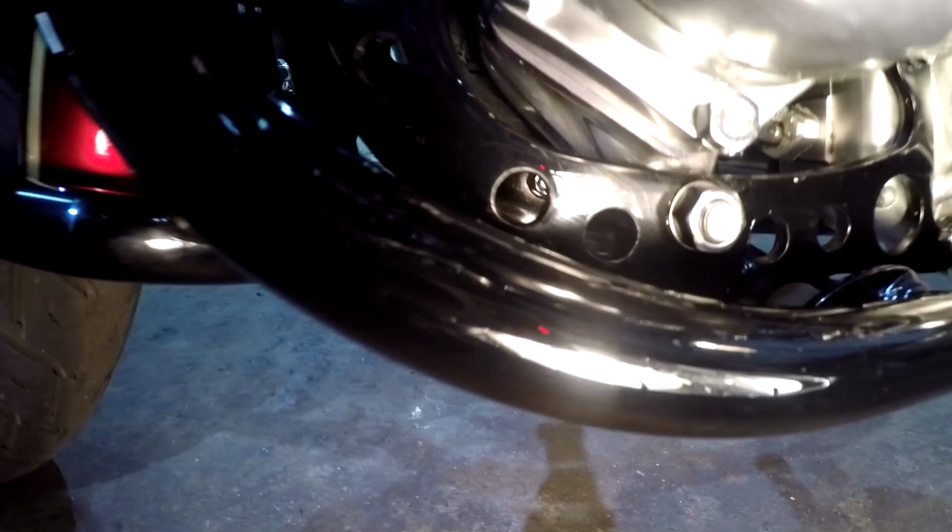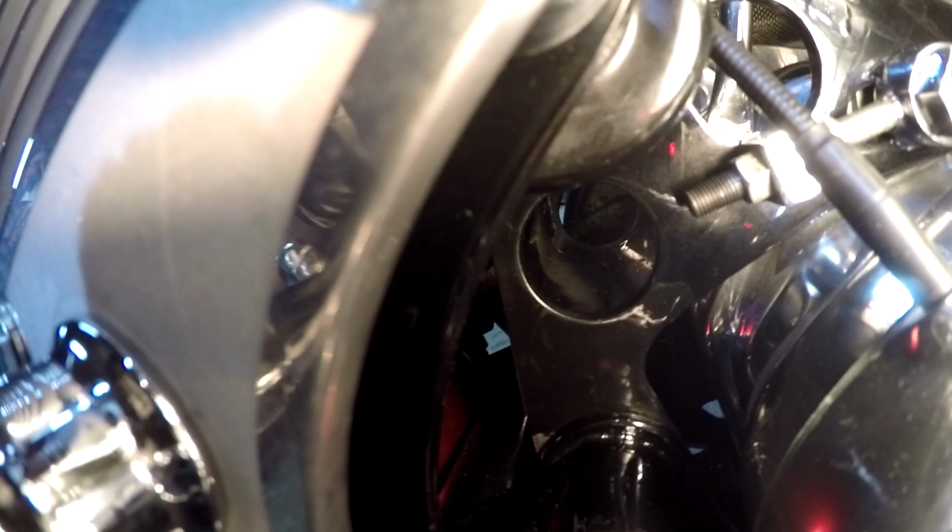is full of holes that I put in to lighten it down, and that makes it weaker, you betcha. Check those huge ones here, one there and one there. Now if you look in there, you'll see some dust. There's a box sectional plate welded to both sides of the cage. So the cage is box sectional there. Plus on the bottom here is a huge cross member of square tubing. You see it there? That's square tubing welded to each side of the cage. So the cage has got this huge cross member welding both sides together. I don't expect this cage to be flexing or breaking at any time.